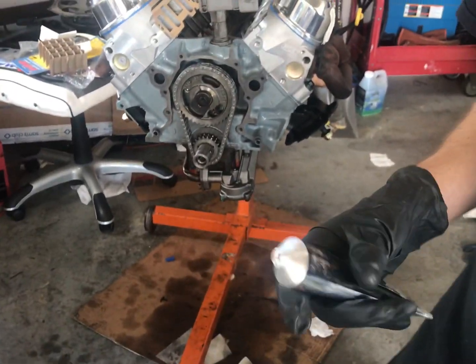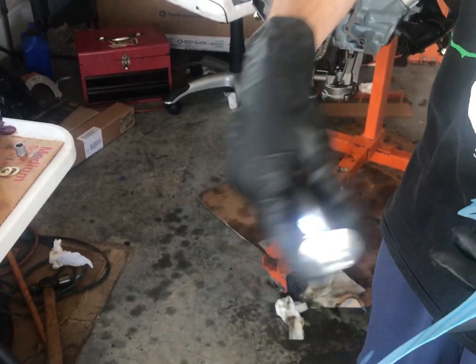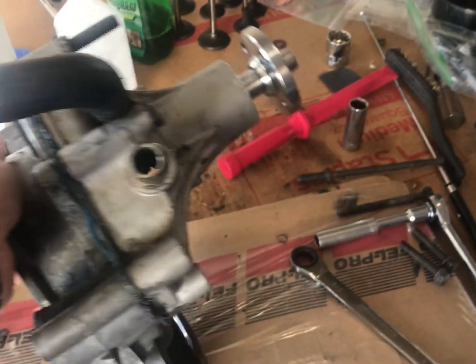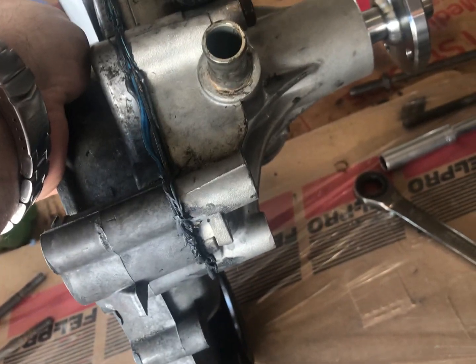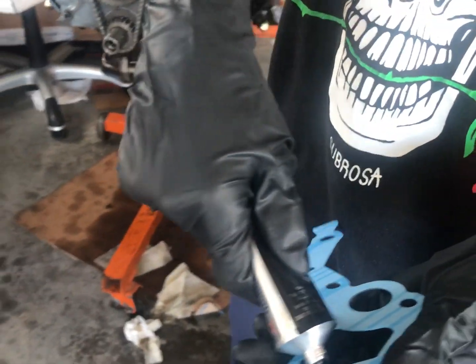All right, we're getting close. We're going to slather on a little bit of sealant on both sides. We're going to glue on the timing cover, and Austin has decided, since we had just glued this timing cover on before the engine coughed its guts. This water pump is glued to the timing cover, so we decided just to leave it - we're going to risk it. I don't think it's going to leak. This black Permatex Ultra RTV, this stuff is like glue. It is unbelievable.